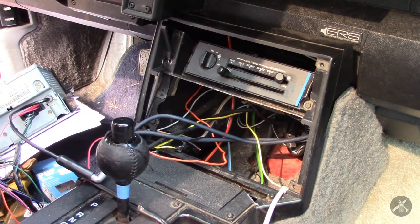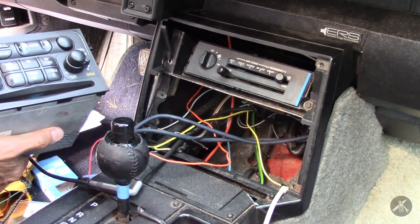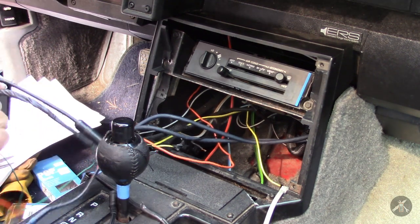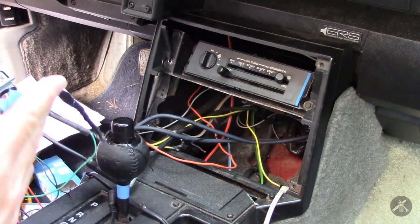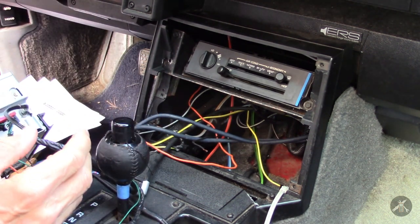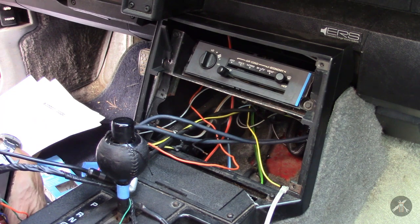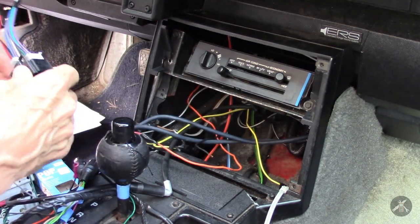I'm back after several hours of wiring. I'm working with this Delco Electronics Avalanche radio, since it happened to be one I have on hand. The nice thing about this radio is that in addition to a CD, it has auxiliary input. This radio has a set of cables coming out the back — a twisted pair with a foil shield — then spliced into a stereo headphone style jack. When the original owner had this done, they cut all the original factory connectors out of the car, so I'm really trying to restore that if I can.